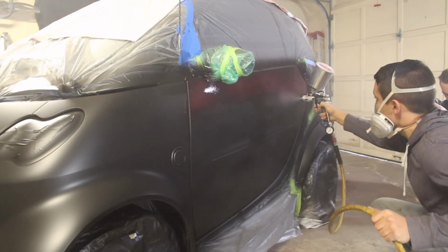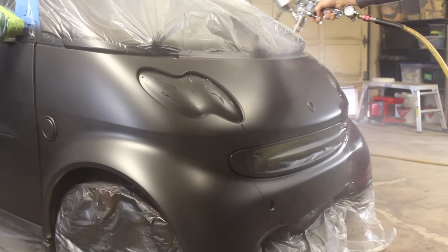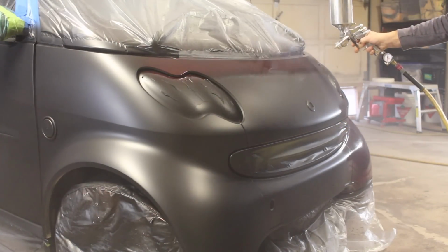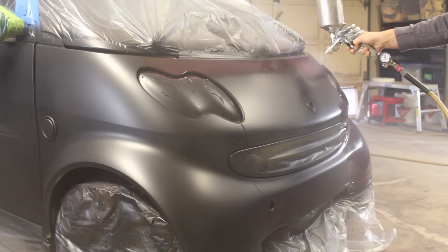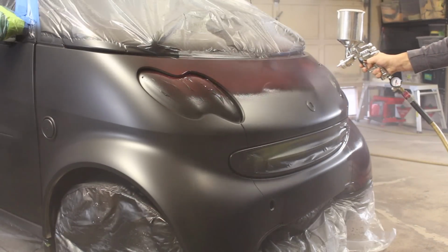If I were to do it again, I would go with 75 grams per gallon as it goes on pretty light. Now something to keep in mind is that the color of the base coat will affect the color of the pearls, along with the color of the car when it's going to get warm. If I went with a white base coat instead of a black one, I would have a bright red car that would go a white pinkish color after it gets hot.